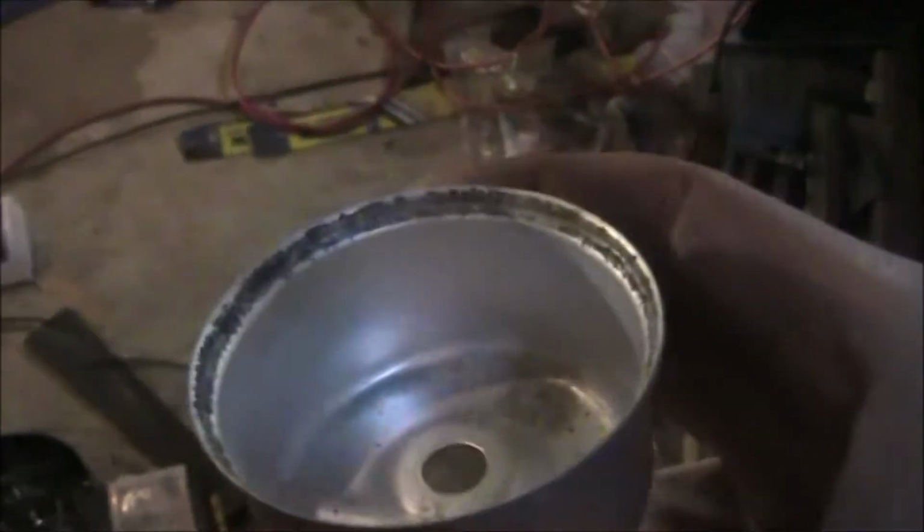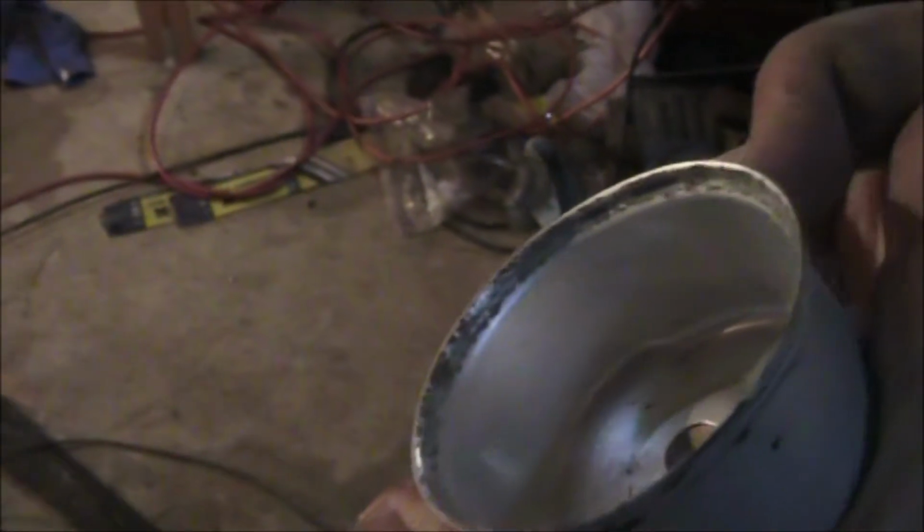Oh yes, I put my carburetor parts over here. I've got a little bit of stuff from over the years. I've got a ton of 6.5 horse series air intake mounting carburetor gaskets. Here, this is a fairly nice example of a gasket that I tore off, and it's all worn out, crusty, dirty, and it's got stuff in it. You can see how the lip there has gasket residue on the inside. That's going to cause your float bowls not to seal right. There's that, and this also has the shallow end, like I was saying.